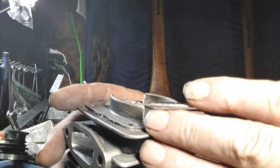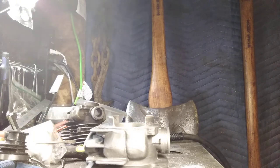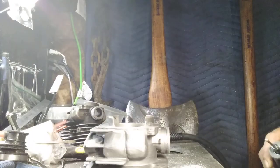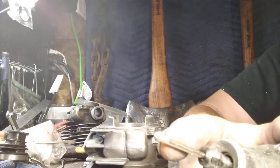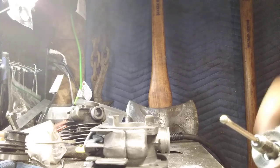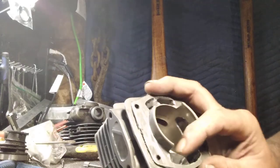Now I'm going to show you something. I'm not ready to deburr yet, but you need to see what I do. If you're not comfortable with this, don't do it this way. I'd rather you take a longer time and do it right than a short time and do it wrong. This is a little diamond. If you can't find one of these diamonds, you can use a small ball mill. What I do is just break that edge where I've already cut. See, I've cut right here.